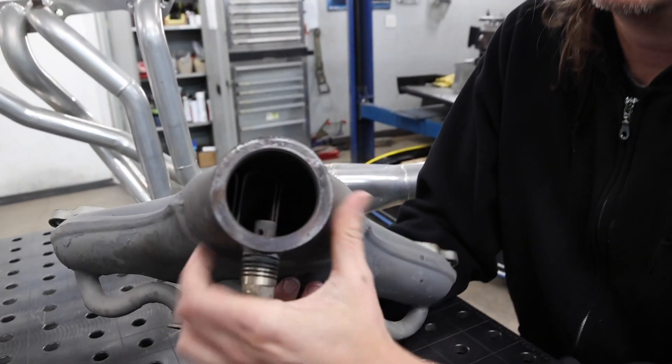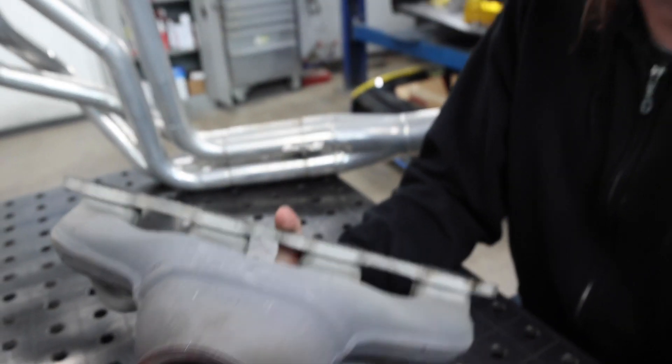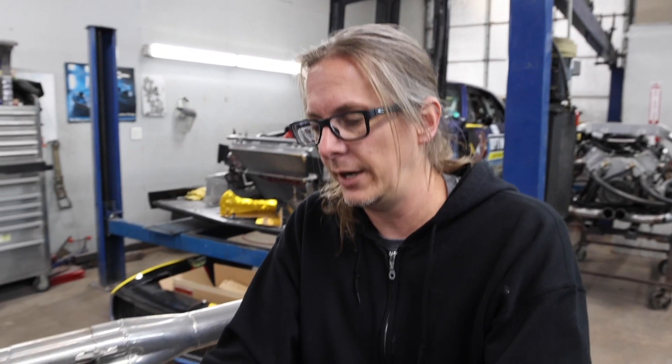If you kind of look in here, you'll notice that they're all different shapes. So you're going to get different flow characteristics out of all of these different shapes, where you're going from a D shape into a rectangle, or some of them have a D that rotates and changes shape. All of that isn't really going to allow the flow to be as consistent. It's going to make spots where we're going to get pressure differentials inside the tube and some restriction.